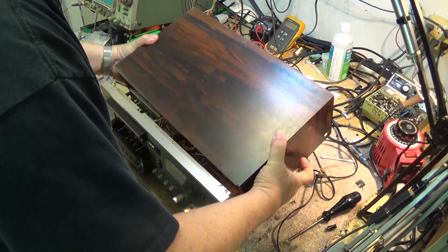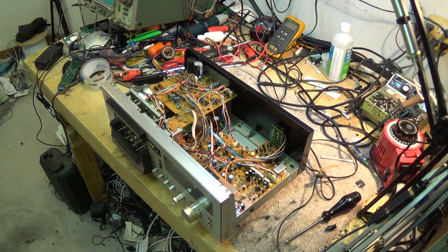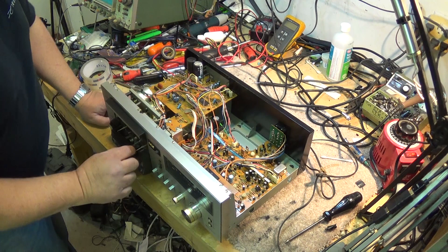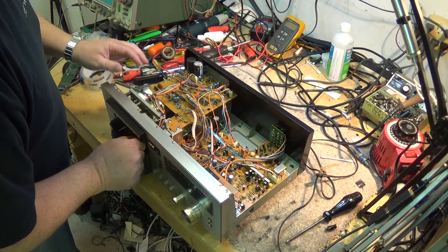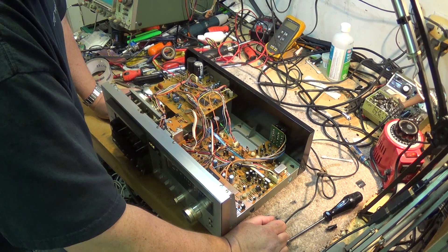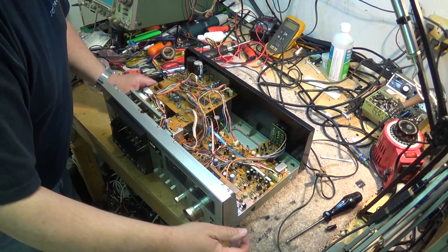We'll lift the top off. Nice wooden cabinet here, and reveal a very well-built tape deck inside. There are two motors on this one. It's got a belt-drive capstan motor, and the belt is actually okay. But this motor spins very, very freely — it's not like your conventional decks where the motor itself has a lot of internal resistance to it. That's what kind of threw me initially, but it is a nice easy-spinning motor. There's nothing seizing up about this.